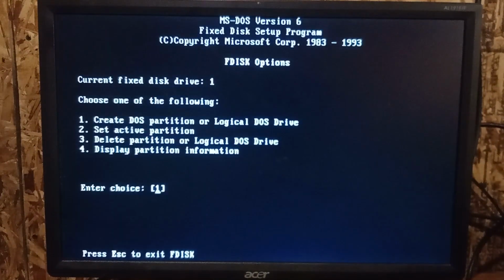Let's just look at fdisk for a minute. See if fdisk even sees two drives in there. Should. I would think it should. No, actually it doesn't. So, yeah, you'd have to boot with a modified BIOS that ignores the USB and boot from a floppy to set the Disk on Chip as an active bootable drive, which is a piece of cake. It's just like any other hard drive.